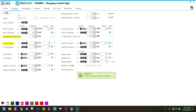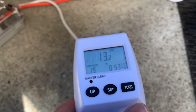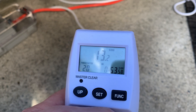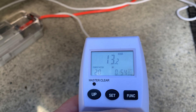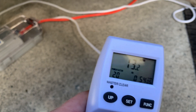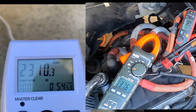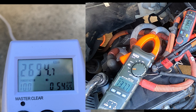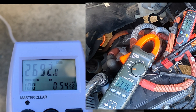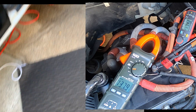It was on Manual Off — that'd be why it wasn't working. We go from Manual Off to Manual On and save. So now we've got it Manual On rather than Manual Off. I'm no expert at this side of the Batrium software — I've never used the charge limiting — but it does work, we have tested it. And there we go, it's kicking on.